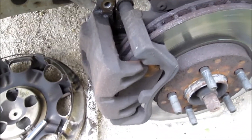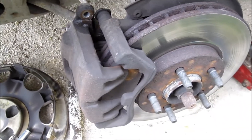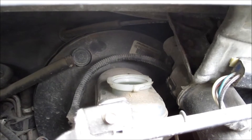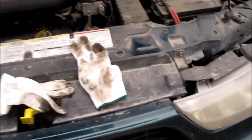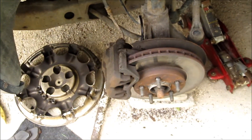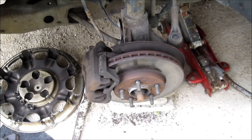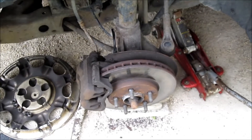Just got to do the same thing as the passenger side of the vehicle — pushing the calipers in. You see how that brake fluid has risen but it didn't go over. So now I'm going to put the cap on it. Before you put the vehicle back on the road, you've got to start it up and push the brake fluid back into the calipers properly. Otherwise when you first start off, you won't have any brakes. So I'm going to start it up and pump it up a few times.